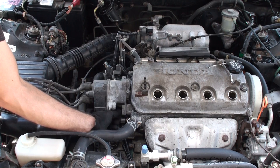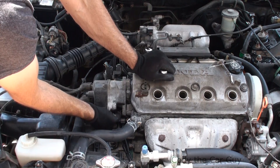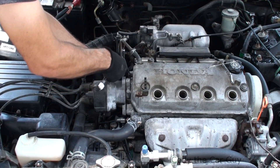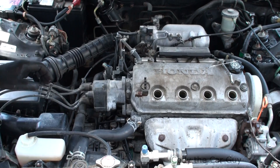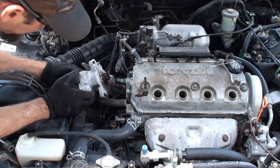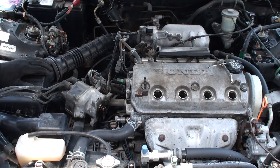All you're going to do is literally pull this out just enough that you can get your pick in there to the O-ring and pull it off. Just wiggle your distributor out. There's your O-ring right there, and as you see it was wet underneath that.